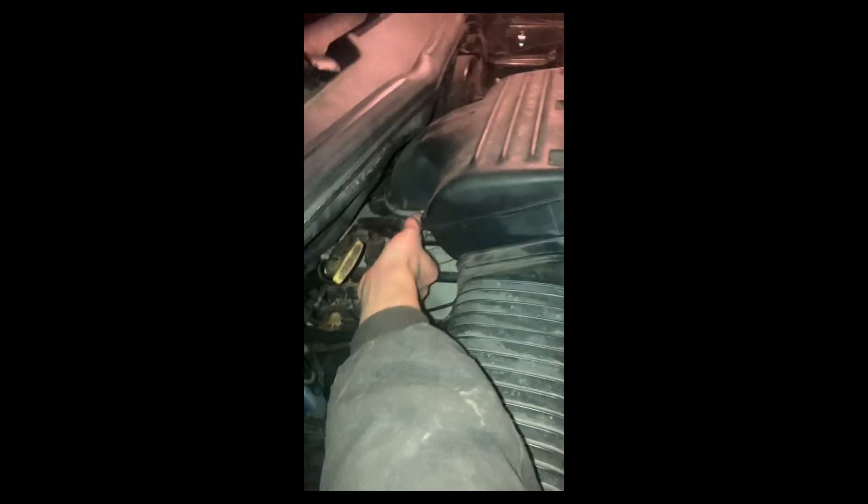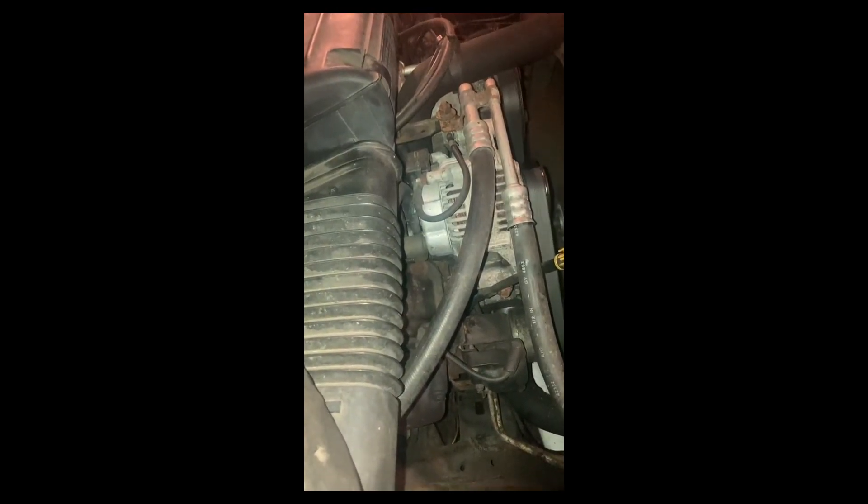I'm going to go for a little test drive — warm it up and see what happens. I put about 10 miles on it. Temperature's up, oil pressure is down a little but still good. As expected, it is ticking. That was a fun last hurrah though — I did a pretty thorough test on it in those 10 miles. It's definitely worse. The answer is the bearing and Lucas trick lasted about 10 miles, maybe a little more.